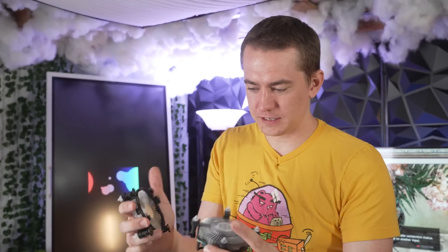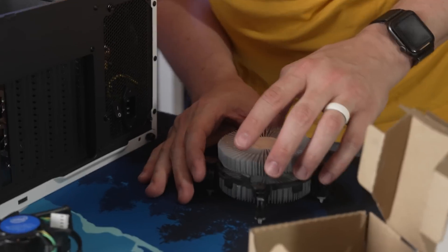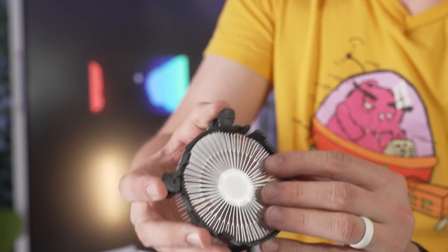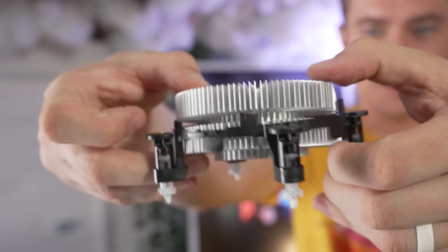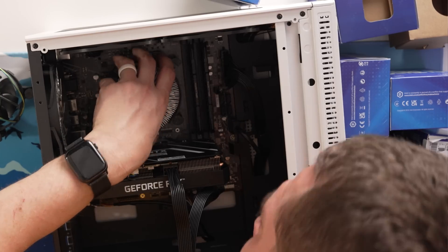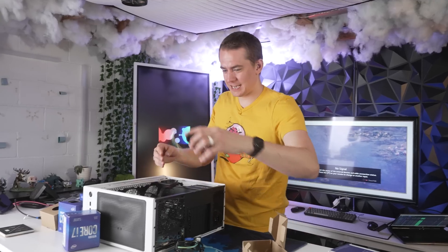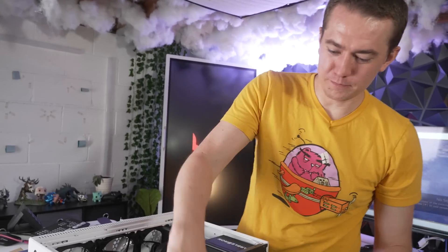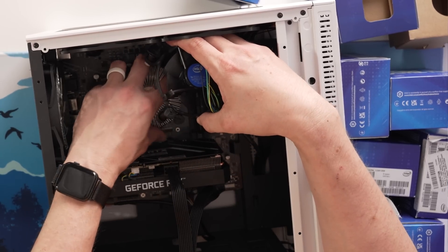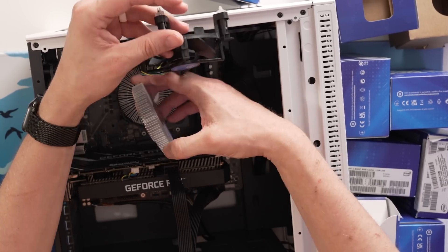There's the core at the bottom we're going to attach this to. I'm going to slice my fingers on these — they're so thin. We want it to go in like this. I snapped the little ring. There we go, that's a double layer cooler right there, firmly attached with my fingers. I don't know how I'm going to get the fan on — that's a problem for future Brett. This is essentially what some of Intel's thicker coolers are. Stacking it like this, I'm expecting a decent improvement.